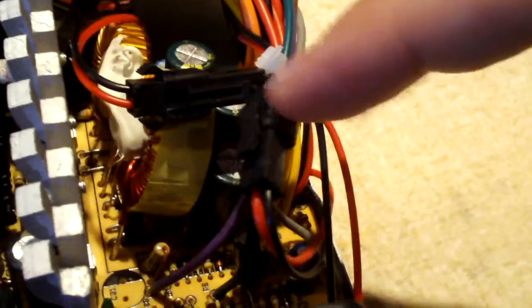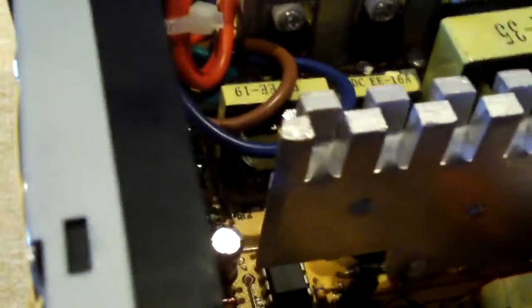Let me get you a good focus so you can see for yourself. You can probably see where it says LF1 in that very small spot there. Other than that, things do seem slightly better. We have two blue capacitors and two electrolytic caps. That black thing is the NTC, and what's shrinkwrapped down there is a fuse. There are the connectors for both fans — there's one fan, and back there is the other, in a push-pull configuration. So we have OST capacitors here, here, and one over here.